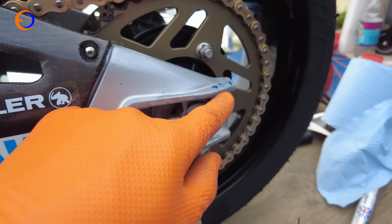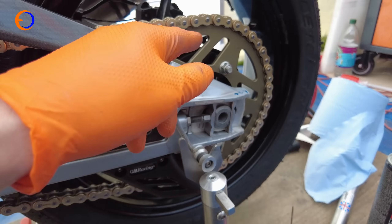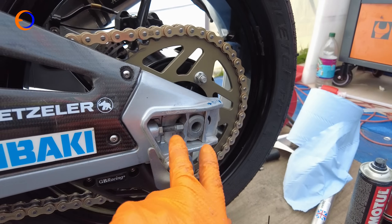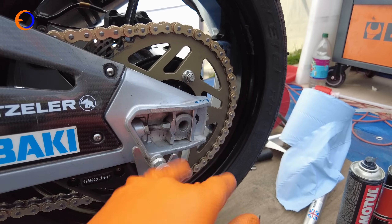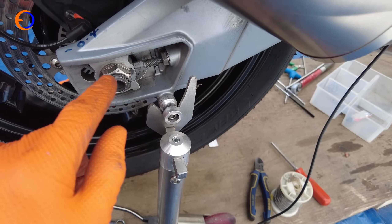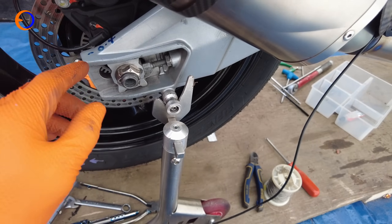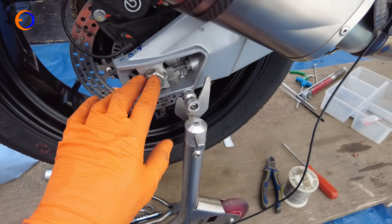There's a little measurement mark on the top of the swingarm. In the workshop we had a pair of straight edges running between the wheels with a chain alignment tool, and we know that this side adjuster needs to be 0.4mm further out than the adjuster on the other side. So we get a vernier in between the block and the swingarm, measure this side, and then set the other side to suit. I've made sure everything is tight and re-lockwired the nut — running the lock wire from the adjuster bolt around the thread so the nut can't come off. The bike will have new tyres for the race, but if we do a warm-up lap it'll run on this tyre, so I'm double-locking everything.